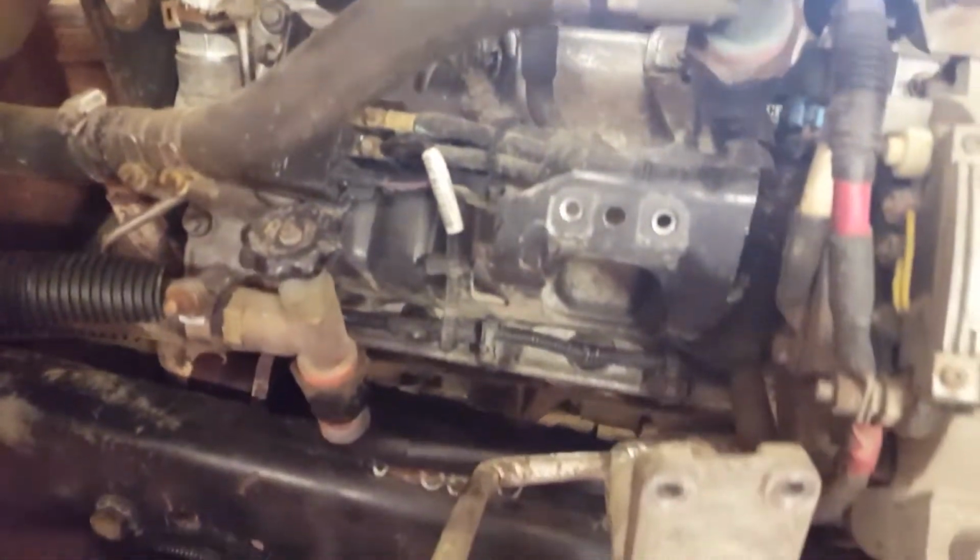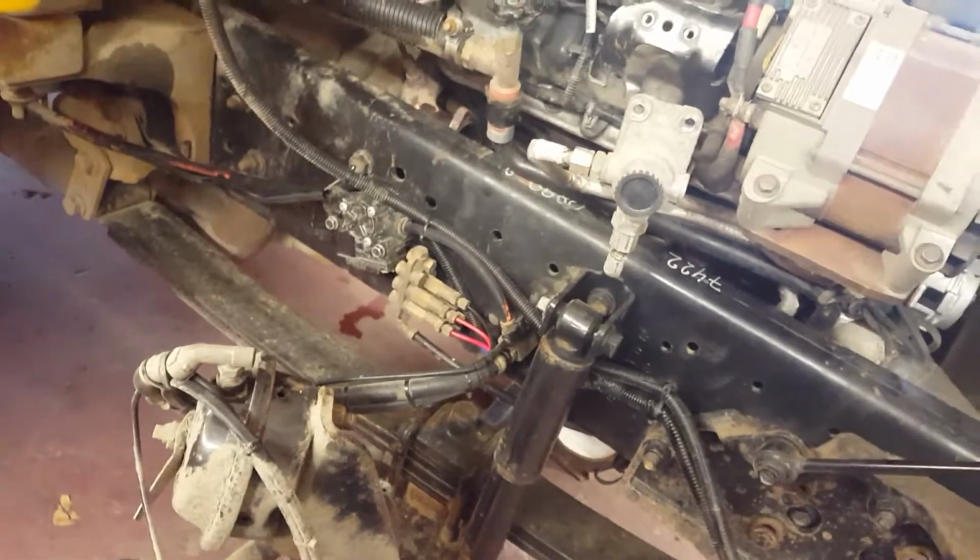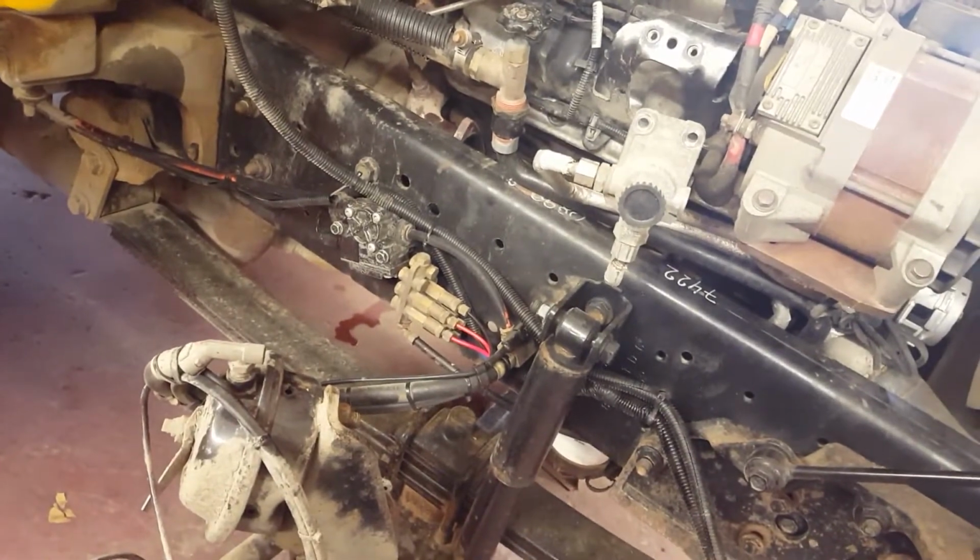We've already got the exhaust manifold off. We got an exhaust leak, which you don't allow in school buses at all. It's out of service, and we can actually hear a whistle at idle, so it was a bad one. And we've loosened it off the EGR cooler, the top end, and got access to the retainers. We got it off.